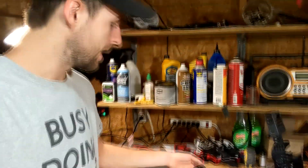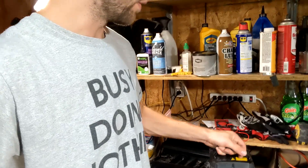Another thing with bypassing your BMS is voltage sag. Voltage sag is when I'm pulling 8,000 watts but the voltage of the pack overall sags. So as you get closer to zero, don't pull as much — don't have wide open throttle when you're getting close to zero because your voltage is going to sag way below a safe level.